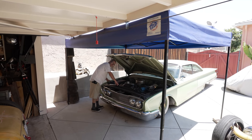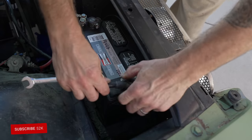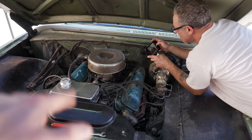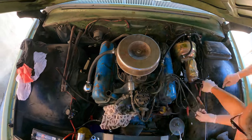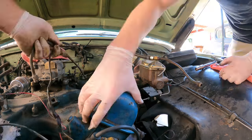The first thing we're going to do is drain all the fluid from the radiator, because when we take off the intake we want the least amount of fluid coming out. My dad is taking photos of everything so when we take everything off we have a baseline idea of where everything goes. Now that the coolant's drained and we took photos, it's time to take everything apart.